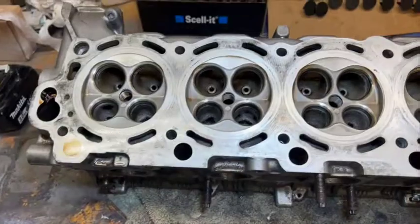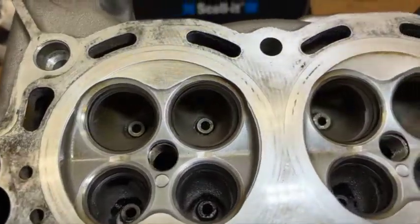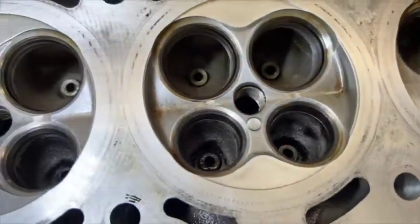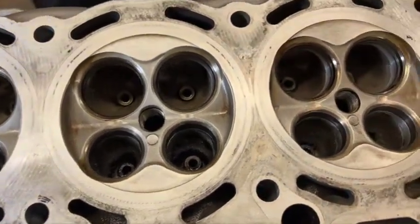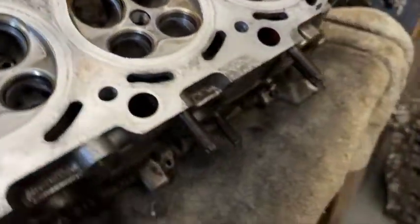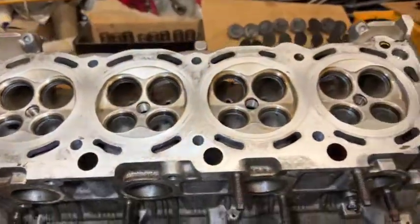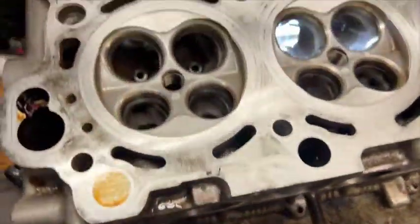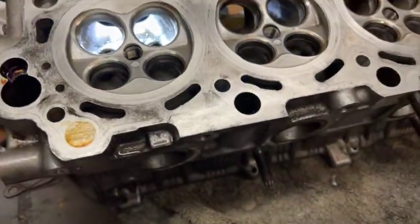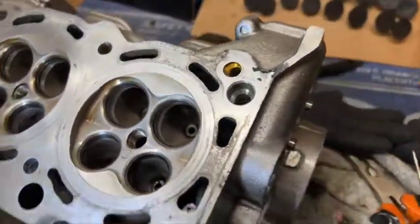Right, well that was a bit of a mission. Look what we've got now - nice clean and tidy ports. They're a bit wet because I've been cleaning them. There's a couple of teeny bits of carbon which I just can't really get to, but compared to what it was, you know - how far do you go with this thing? And there's from this side, that's the exhaust ports - a little clean and lovely. Quite nice flowing heads, these.